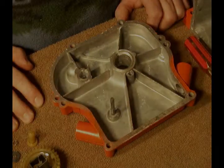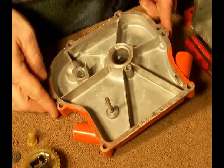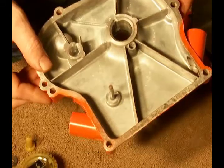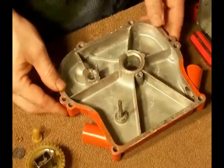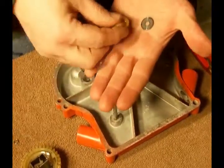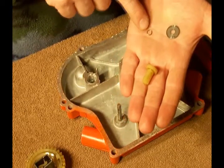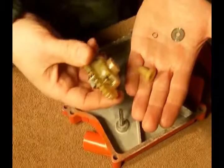What I'd like to show you today is a reassembly of my governor gear from this Briggs & Stratton 5-horsepower engine. First, we're going to take this crankcase cover, sump cover, and the parts that we're going to put in place here. There's a flat washer, a little ring, and the parts of the governor.